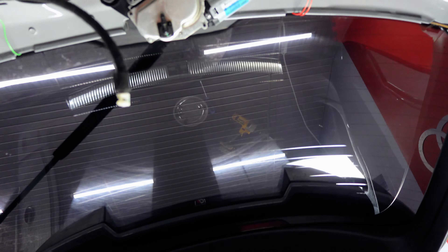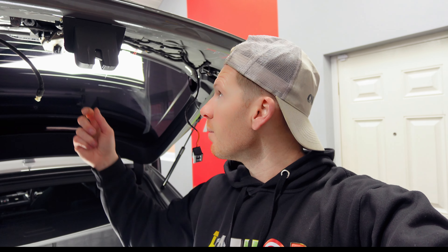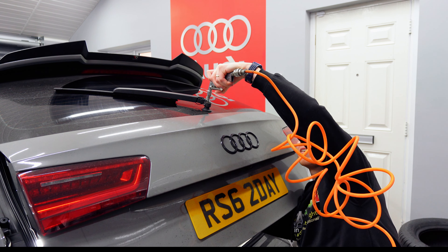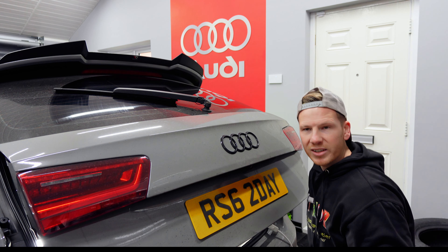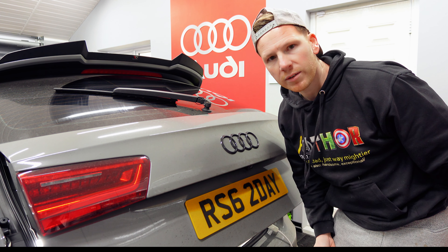So what I'm expecting is some crap to have come out of here, but it doesn't look to be a great deal. What I might do is try and blow at one end and feel at the other end — blow some air in one end and see if I can feel it with my finger at the other end. If I can't feel anything, I'm going to have to roll my sleeves up and take this motor bit out. Hopefully it's a nice simple fix — no flooded carpets and not going to be a nightmare.